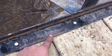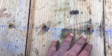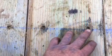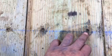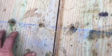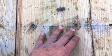And this here, which is a pretty good sized piece of steel, is acting as one big washer all the way across. These are special screws just for putting on decking on trailers, and they are really, really nice. Just pre-drill a hole, self-tapping screw, and it goes right through the frame. Really nice. Really happy with those, and they really bit down good.